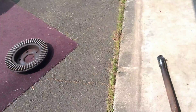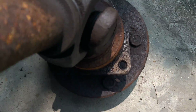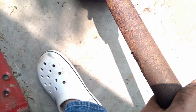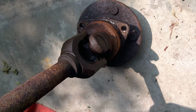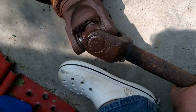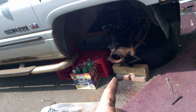So I took the three 14s off on the back of this thing. These right here, the three 14s, there's this one, and there's this one. I used it with a 12-point socket. Another failure, which I've been waiting to do, but it didn't stop the truck, was the replacement of that front universal, which is completely shot. I'm onto that right now at the same time as I repair the brakes, but I was just hobbling it along. But I got the three 14s off on the back, which hold the bearing assembly onto the knuckle.